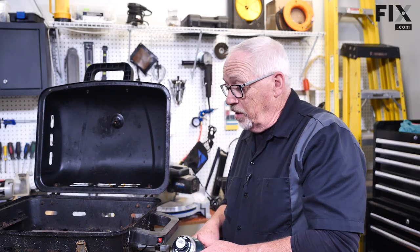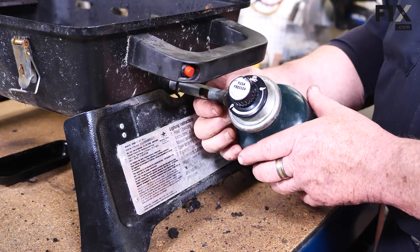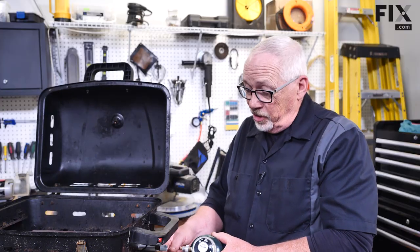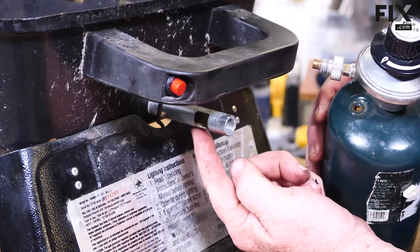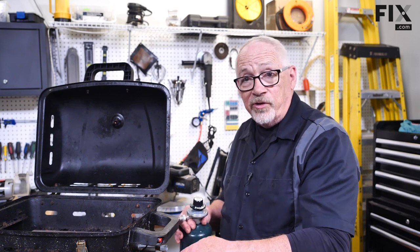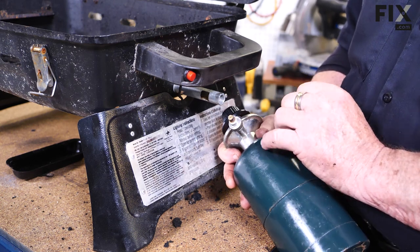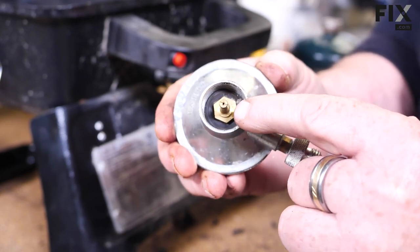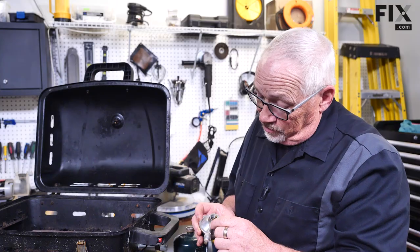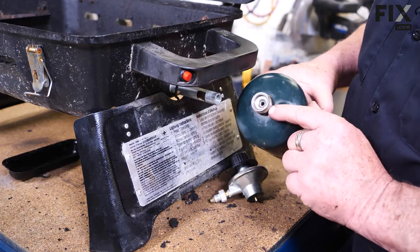One of the key pieces of any gas grill, big or small, is your fuel tank and fuel regulator. On this one, the regulator just threads off the burner — yours may attach with a clip or prong, but there'll always be an opening in the burner, so check that it's clear, as it allows air in for your flame. Where it connects to the tank, make sure the small hole is clear and that the rubber ring — just like a garden hose has — is in good condition, in place, and not torn.